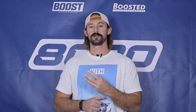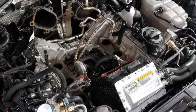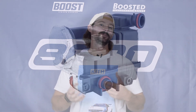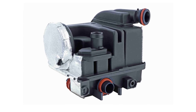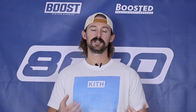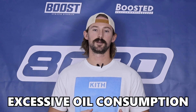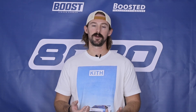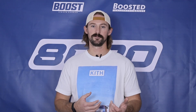Third on our list after the turbocharger issues is PCV valve failure. The PCV valve is located near the valley of the engine where the turbochargers are, so it's also subjected to a lot of additional heat, and that causes it to fail. When the PCV valve fails, you'll get some lean codes, excessive oil consumption, and some rough idling. Fortunately, all you have to do is swap out the PCV valve, so this ultimately isn't the biggest or most serious issue here.